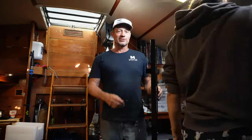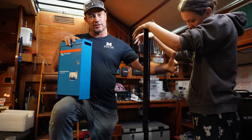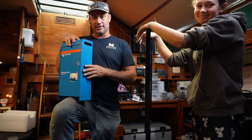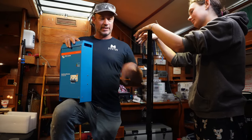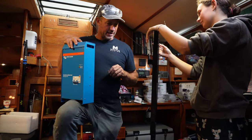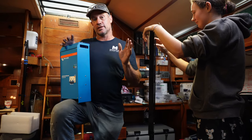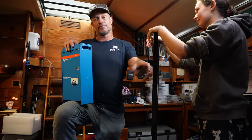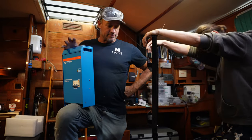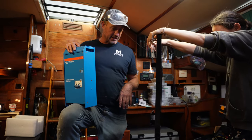Bella's going to hold this and I'll give you a bit of an idea on what it's going to look like. On this side is going to be the 240 volt coming in to make it 110. We're going to have two separate legs of 110: one's going to go to our 3000 watt Victron inverter and the other one's going to run to our main circuit which has the aircons on it. In between these two we'll put a couple of outlets so if we need to run 240 — for instance, a welder, dive compressor, or washing machine — we can do that, or we can run through the Victron inverter which gives us our 110. So we've got both voltages and it's a pretty simple setup.